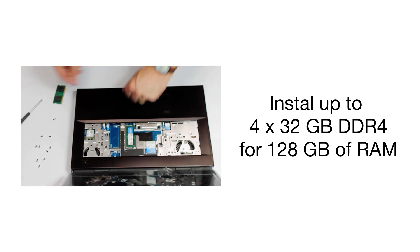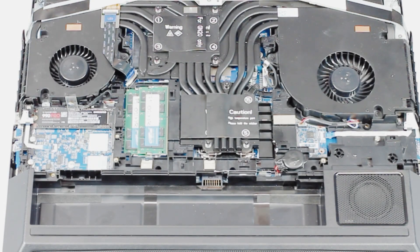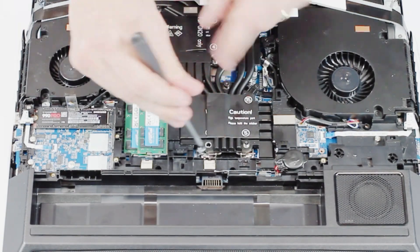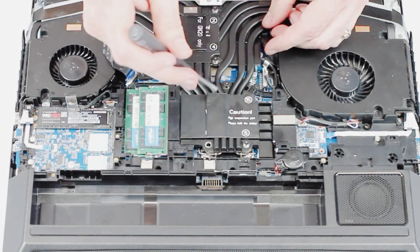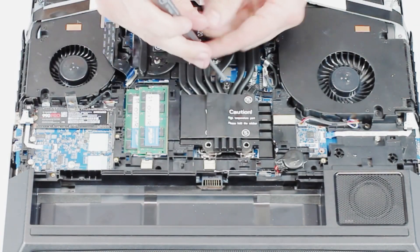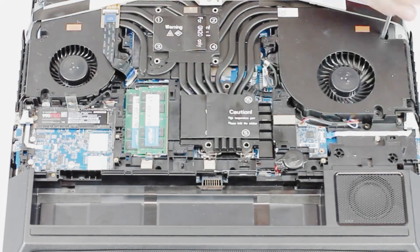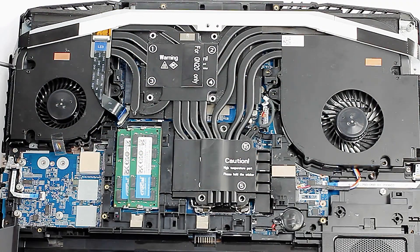There's the wireless card. Take the two screws out and take it off. Next we'll look underneath the heat sinks — there are a bunch of screws to take out. The four screws over the processor are spring-loaded; you can see there's a small spring on each one. It just keeps you from damaging the CPU by putting the screws in unevenly, giving a little cushion.